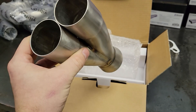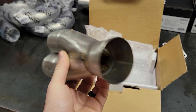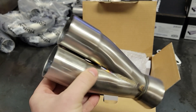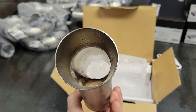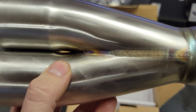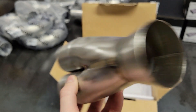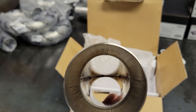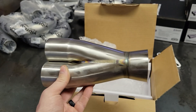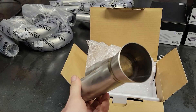Here's one of the mergers unboxed — it's a two-inch slip-over inlet to a two-and-a-half-inch outlet. Super nice piece for the cost. I could duplicate these at home but it's just not worth the effort; they're not terribly expensive and the internal welding down the middle would be insanely hard to replicate. These guys weld the inside and some of the outside, so they make quick work of that with tooling I just don't have. Anyway, I'm going to get the flanges bolted on and start tacking up primary tubes.